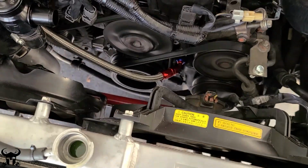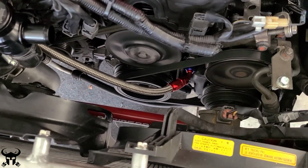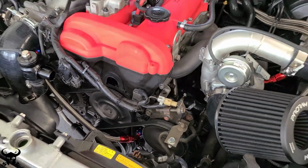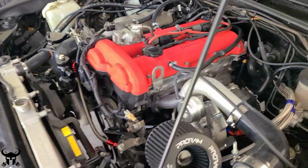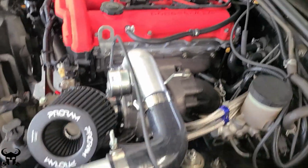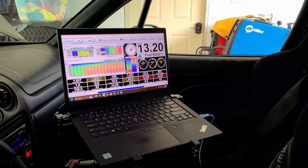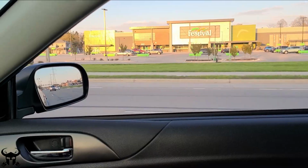I replaced the barb fit silicone hoses with this custom AN6 fuel line, rated 6000 PSI. And then I also replaced the 2 silicone hoses that went from the coolant reroute to the turbo that Kraken supplied. On the next video that I post in the series, I'll go through all the modifications I made to the system. And look at my AFRs pulling in.